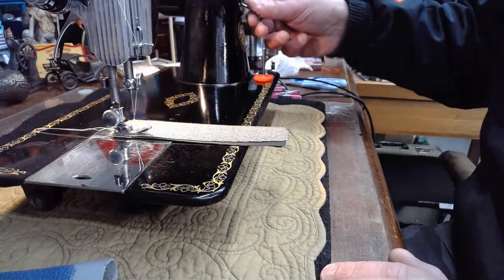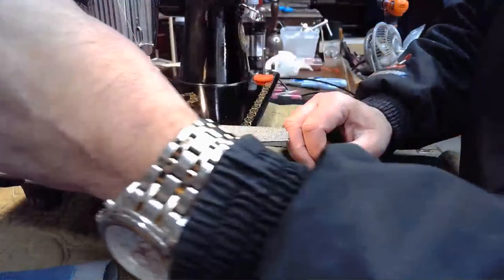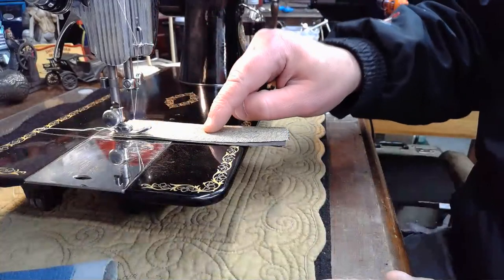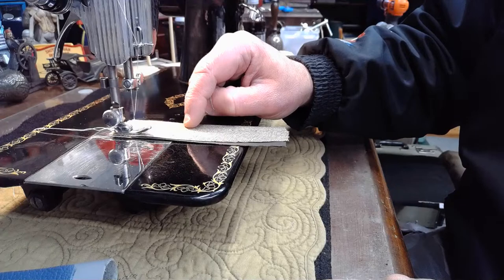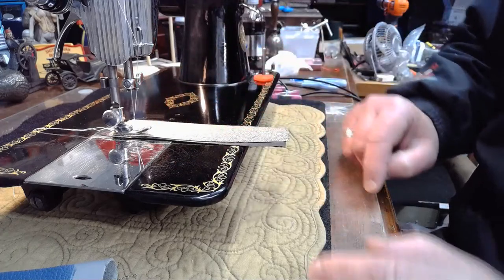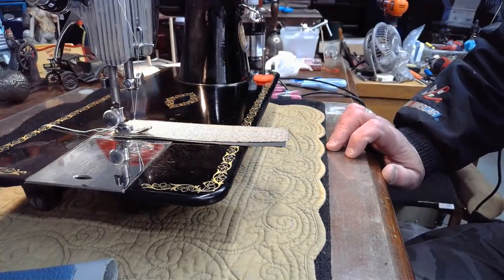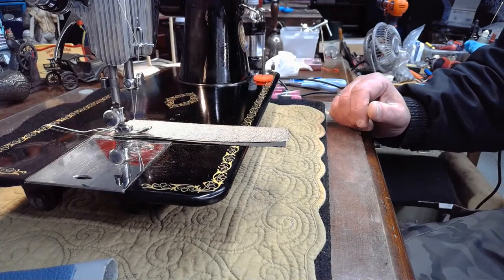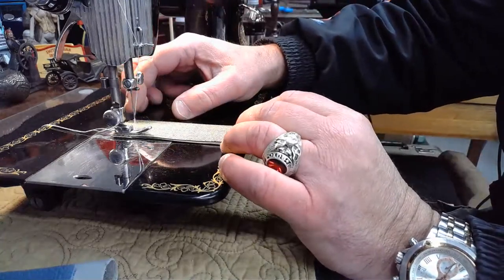We'll go down with a stitch line of probably 6 or 7 stitches per inch. And then I'm going to bump up our upper tension just a little bit. Then we're going to go down it again with a stitch line of about 15 to 20 stitches per inch going down this same material. So we're going from crazy to crazy, crazy. Let's give it a try. Oh, bye, Christina. All right, let's give this a try. No hand start. We're just going to jump into it.